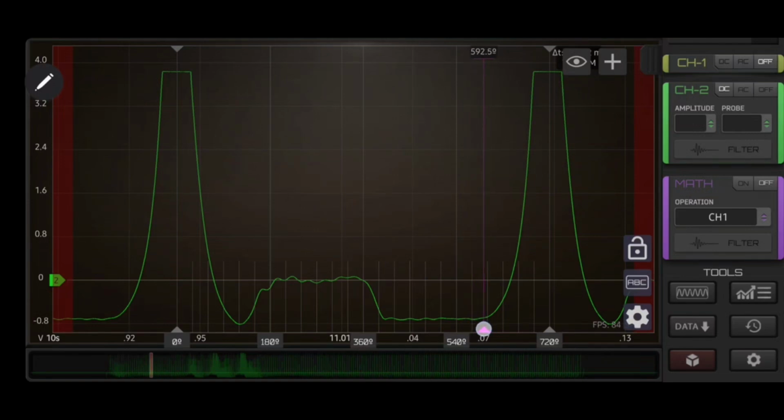Now see, we're starting to rise a little closer on time. See, we're already rising before we get to the 60 degree mark on this one. So this intake cam is darn close. I mean, that intake cam on this bank is probably in time, but this exhaust cam is definitely out of time.